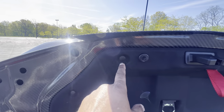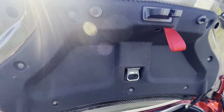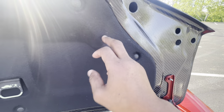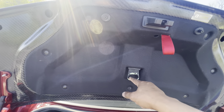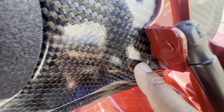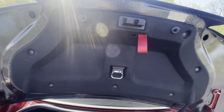You have to drill out holes for these tabs right here to hold on your felt liner. You also have to drill out some holes for your harness that attaches to the actual trunk. But it's not that complicated, honestly. You've also got to drill out some holes for this emergency release. They do give you like a little reference point — a little dimple — that gives you a general idea of where you may need to drill for these holes.